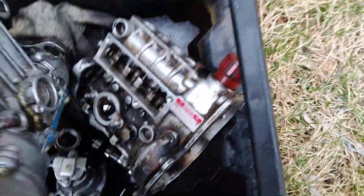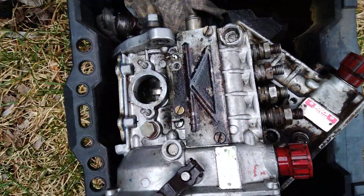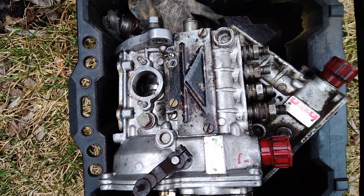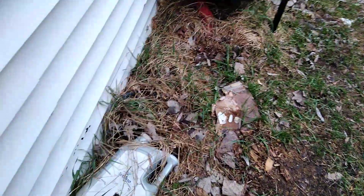I think I'm going to end up building up another injection pump. I got to take some of the pistons out of this one and put them in that one — that's the one I put the cam in. I think the main problem was the injectors were bad in it, and the fuel pump — I had a few problems with it.